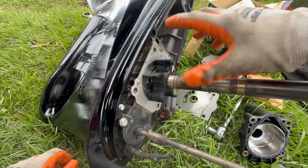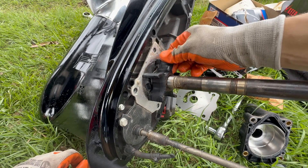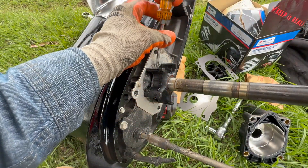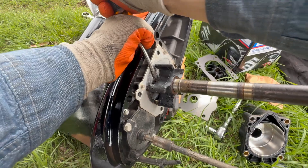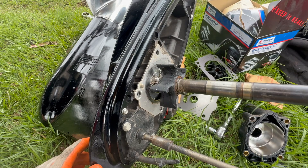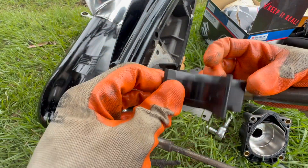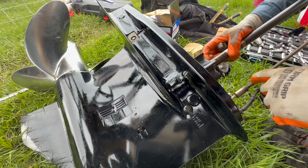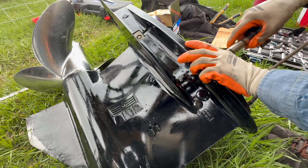This is part of the main reason you do not run these motors when they're not in the water — the water pump is always spinning and if there's no water it rubs on metal and will melt the rubber impeller. Always have your motor hooked up to water when running it. To get the impeller off, get a screwdriver underneath it and work at it a little bit. Rotate the shaft to the opposite side and give a little push. Keep a mental note of the direction of rotation and which way it came off — the keyway is exposed on one side. Put a little bit of gear oil on the shaft to make it slippery and then it should come off easily.